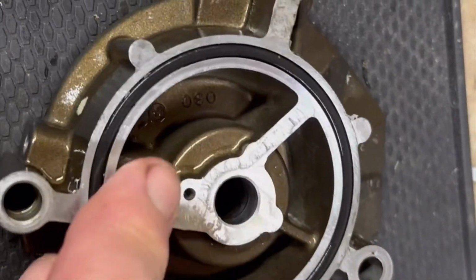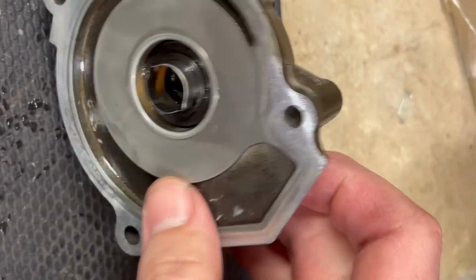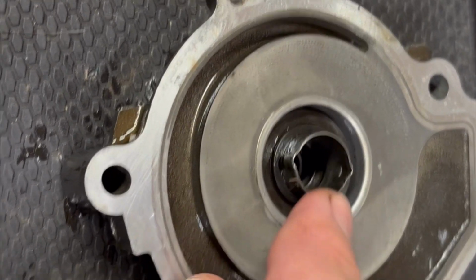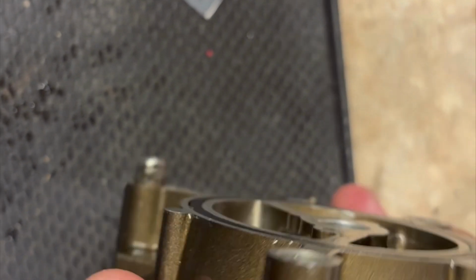So this is the back, and obviously this hole here sits at the bottom of this water pump housing body. So this seal, which we're going to replace, there's the new one. Obviously that had failed and coolant had got behind into that chamber, and that leak in that hole there is a telltale sign.